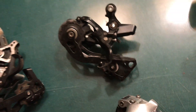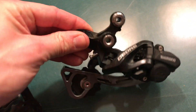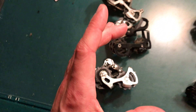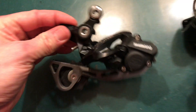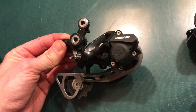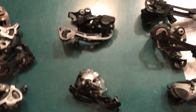Really the only way to figure it out is to get every derailleur from the same line — like the Deore line — same model number, just short, medium, and long, and then measure them. But this is just a quick overview. You usually see the short cages on road bikes with small-range cassettes and a double ring up front. The longer cage ones you see on 1x cross-country, all-mountain, enduro setups where you want a huge range in the back and one chainring up front.